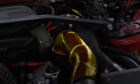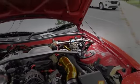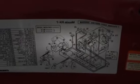This airbox is from M2 Performance. I was able to actually clean up some of the vacuum lines. Speed 1 did this for me. They're shut down in Huntsville. They installed this custom solenoid rack, so it actually replaces the stock solenoid rack. The stock solenoid rack is pictured in this rat's nest diagram there of 42 unique vacuum hoses. So it's cut that down significantly.